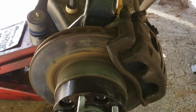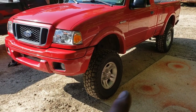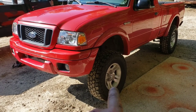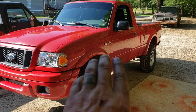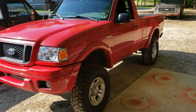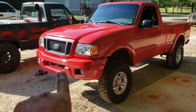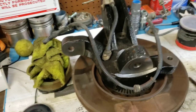One side is done. I uncranked the torsion bars to about where stock is and I had to jack the control arm up to get the tire on, so it lifted it quite a bit. The rear looks kind of tall but that's just how it's sitting on the jack stands — when you put the jack stands towards the middle of the truck it kind of tilts when you let the front down. I think it's going to lift it quite a bit in the front; I may have to get some lift for the rear but we'll just have to see.